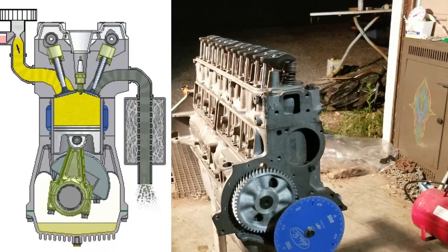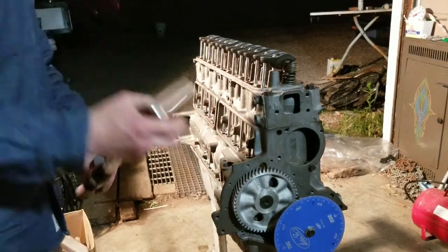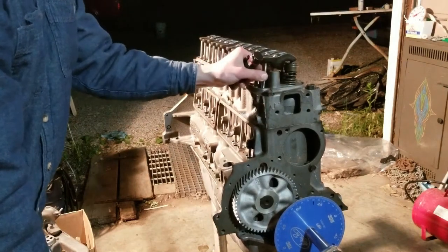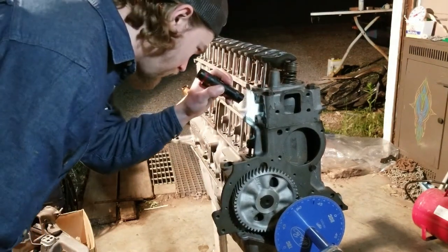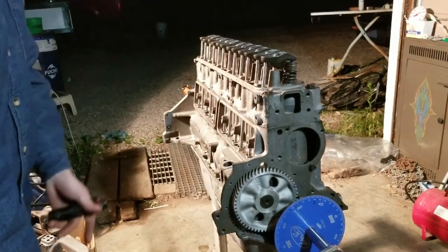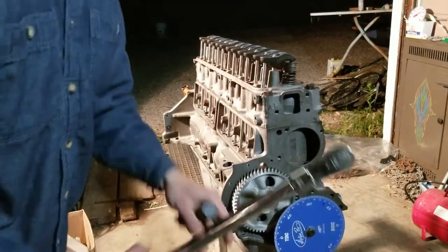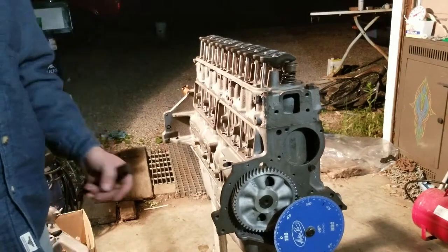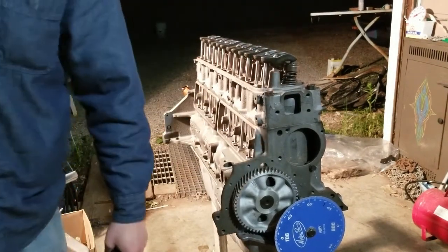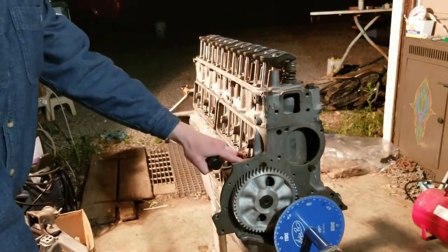You have a window — you can be a little before or after TDC. The way you can tell you're on the compression stroke: these are a little loose, I haven't set them yet, but I can see the piston coming up. You can blip the key or turn the engine over quickly — you can hear that compression. The piston coming up forces air out the spark plug hole because both valves are closed. You can probably even set them now because I can see the lifters aren't moving.